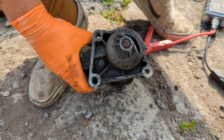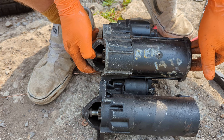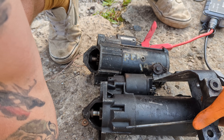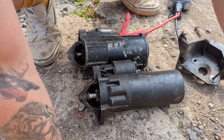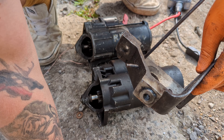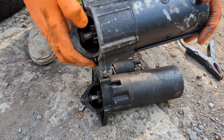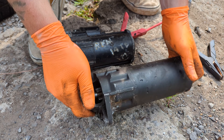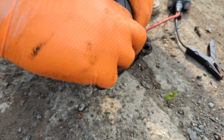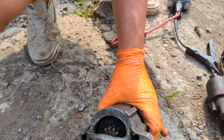There are some slight differences between these two. This is the one I've taken out of the car, this is the one I'm putting in. As you can see, it's a little bit shorter. On the back there should be a bracket that bolts it to the block. I've been speaking to a very nice chap on Facebook this morning who says I can do away with this — I can just have it bolted to the gearbox. This bracket is just so it holds the gearbox in place if you want to take the gearbox out without taking the starter motor. So I can just bang this in. This is a Valeo unit and this is a Bosch unit — I reckon this is probably the 30-year-old original starter motor.